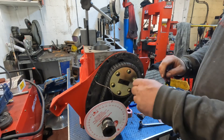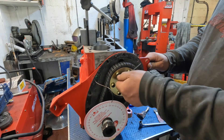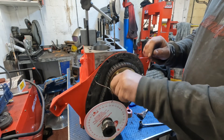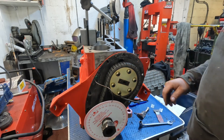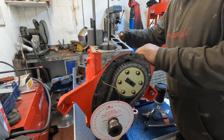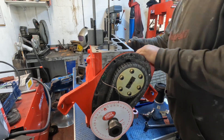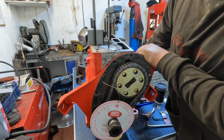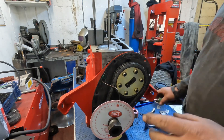I'll go ahead and finish tightening the rest of the vernier bolts. I'll then get the crankshaft at TDC and make sure the TDC pointer hasn't moved. The cam timing is all set — checking TDC hasn't moved — which it hasn't. Absolutely spot on. So I can now just finish off the few remaining bits and then it's ready for the customer to collect.